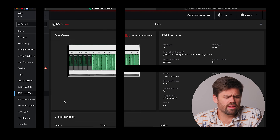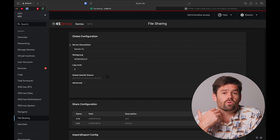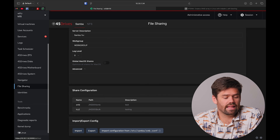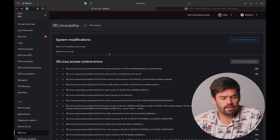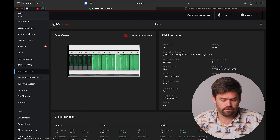For people who are not as used to ZFS — who don't know how to run ZFS commands, blow away RAIDs, or deal with errors — Houston is more difficult to get set up. There are going to be fewer guides out there and more things to deal with. For example, if you want to run Samba you need to edit SELinux to allow Samba to work, otherwise it doesn't have enough permission. If you're used to building your own file servers, Houston lets you customize everything and control it all without holding your hand — it's just standard Linux with a nice web UI on top.